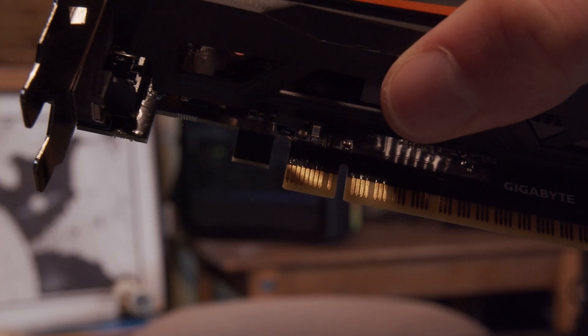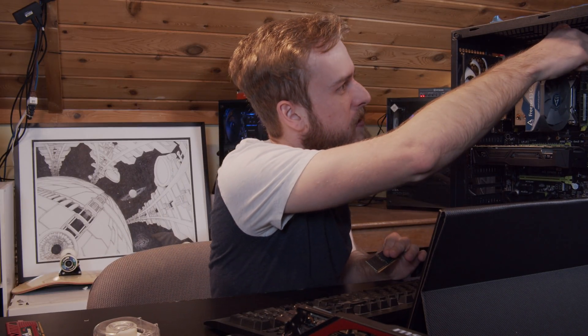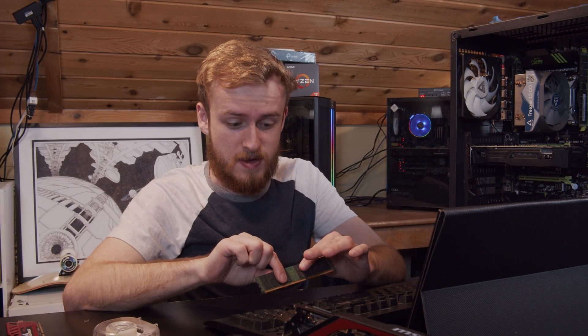So point of the story is obviously the RAM has lots of different pins on them. I would hope by design the ones on the edge — the ones most likely to be clipped — are a little bit more redundant or less important than the ones in the very center. The ones in the center are probably the safest, so they'll probably be used for passing important information. That's why the system is not booting up at all. Also, this RAM module is hot — the other RAM modules are not. That might be a bad sign. Hopefully we didn't cook it.